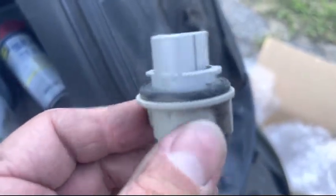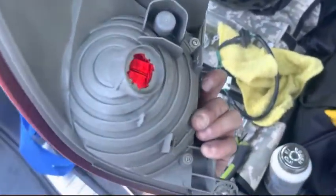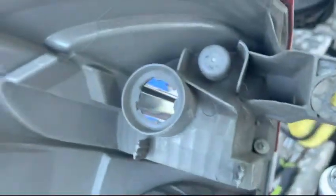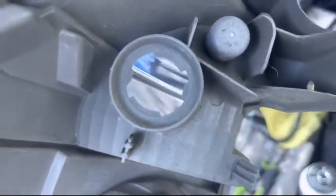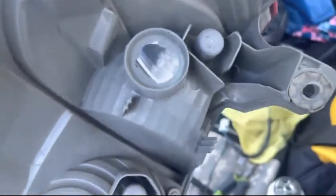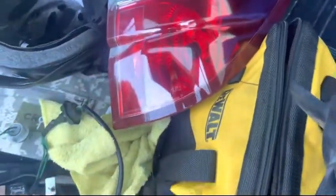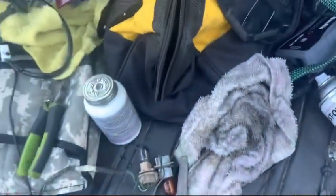So I'm gonna file those pins and then I'll show you guys what it looks like after. This is what it's gonna look like when it's filed down — those are the two ends I told you about, they are filed. This will now fit in the top socket; the bottom one fits like it should but this one does not — it just needs those smaller pins filed and it'll fit fine. I've seen people file the inside of the socket — don't do that. Filing the inside is just gonna damage it and could let water in.